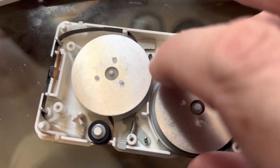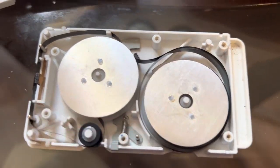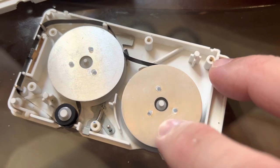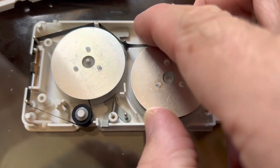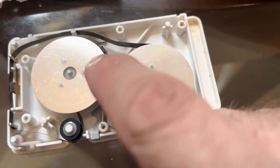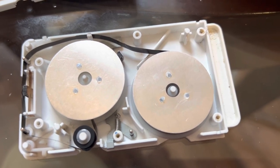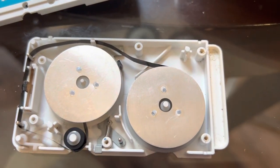This one is frozen. The tape is chewed up and it's all wound out — it's not supposed to be like that. I'm going to carefully wind it back with my fingers until it's snug, then pop these reels off. Notice when I did that, that little piece was behind the little stopper. Before you take anything out — if you're going to mess with this — take a picture of it, because I promise you'll think you know how it goes until you've fooled around with it and then you can't remember how to thread it.